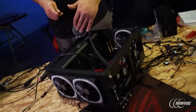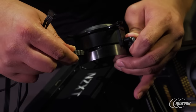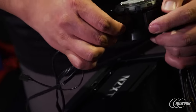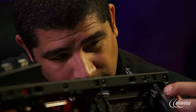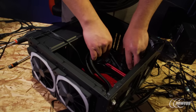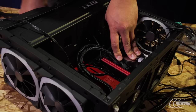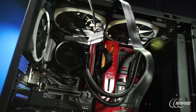Now that we've got the actual radiator mounted, we want to go ahead and connect the actual cold plate and pump. Before you do that, because we're in a small form factor scenario, consider connecting cables beforehand. The Kraken X62 has two connections required: the USB connector and the interface connection. Make sure both of those are connected beforehand to make it a little bit easier. Then drop it down in place, get it lined up — you might need to push those DIMMs out a little bit — and once it's settled in, put on the thumb screws for each of the corresponding sides.